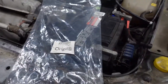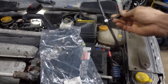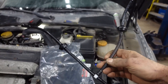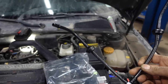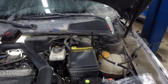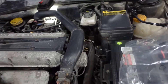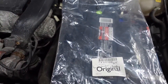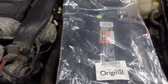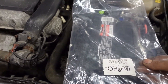So this is the brake booster vacuum line — that's how it looks. It has two check balls on it: one goes to the engine manifold, and the other one goes to the mechanical vacuum pump, which is right there. The part number of this part is 5331095.